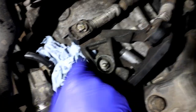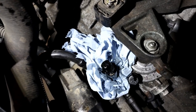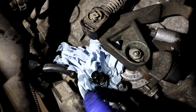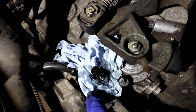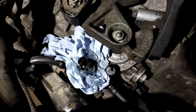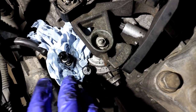Do it up and I'll explain what you're supposed to do. Once you undo it, air will come out and you'll see bubbles. Wait until only clean brake fluid is coming out, then tighten it clockwise — it locks itself and you can do it with your fingers, no tools needed. After that, feel the pedal — if it's responsive and doesn't stay all the way down, start the car and try it. If you leave it open, air can come out on its own and it might be fine.